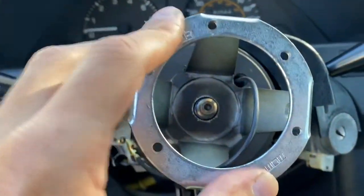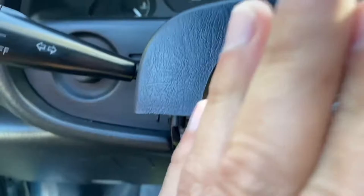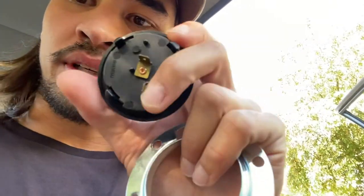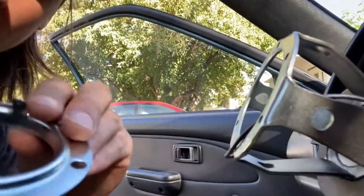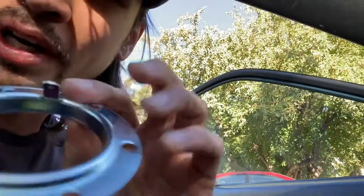The big question is, will we get the horn to work? That is something I'm very, very doubtful about, but we'll see. As you can see, the horn has two terminals here. One wire is gonna be from over here — it should be grounding to the wheel. And then there's another clip here on the Momo button adapter, and we're gonna have to make a jumper wire for that. I'm gonna do that right now.